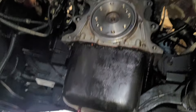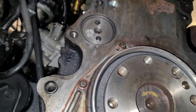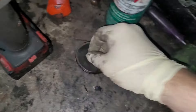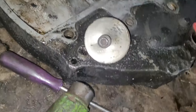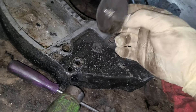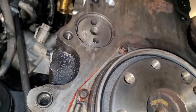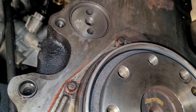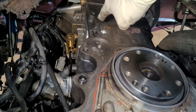If you guys are doing this rear cam seal cap thing, I'm going to show you guys a trick because nobody on the internet is helpful. I got it off, cleaned it out — I know 100% it was leaking. I saw it dripping. We got the new seal coming, so we're going to pop a new seal in there and a new cap that should be here by Friday. If you guys want to get these done, you have two options: one, drill a hole in the direct center and shove a bolt through it. By the time I figured it out, you can probably just shove a self-tapper in there, screw it all the way in, and it'll pull this thing right out. Any other way — good luck. I was watching Cutter Up — Rob did a video on this. He fills the inside with sealer and then pops the new seal in. I'm going to put the O-ring in with some sealer.